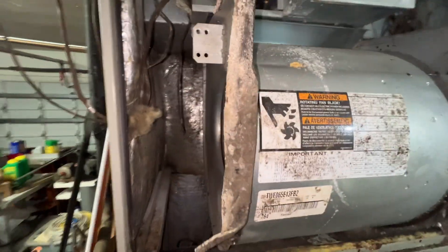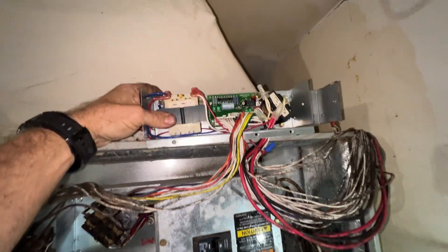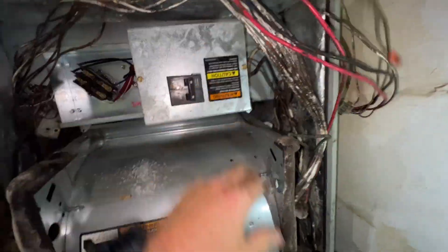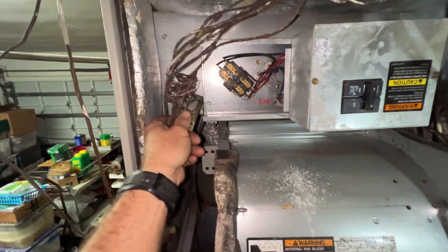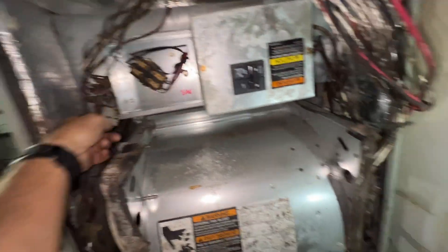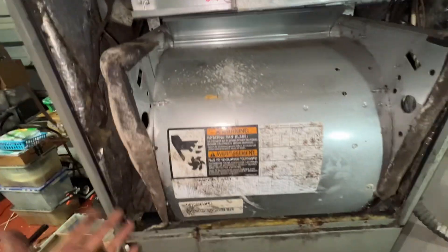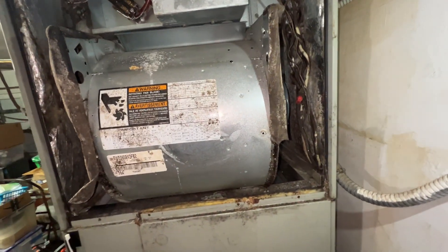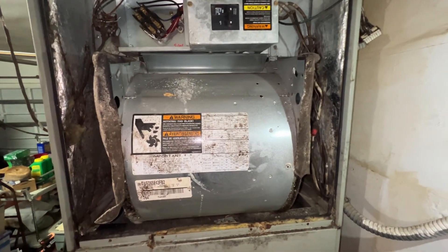So what I do is kind of power off. I disconnect the transformer and the board compartment and just unscrew it. There's two screws on each side, pull it off. Take the terminal strip — just two screws hold that on — and unplug everything from the wire, the motor, and just toss it up here. Pull your blower assembly out and we'll swap out the motors and then go back and reverse and wire it back up and make this thing work.